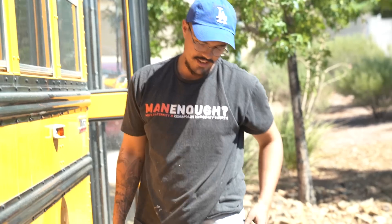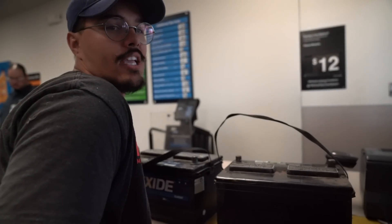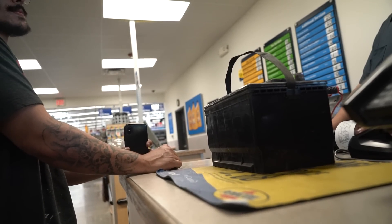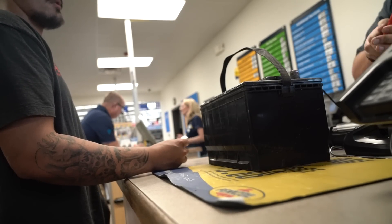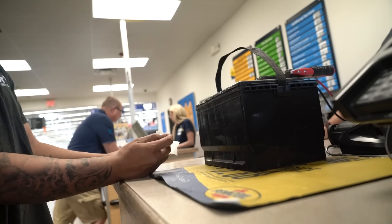This is literally the hardest battery change I've ever done in my life. Usually you just take off the two clamps on top and pull the battery out. We're hoping they have replacements — trying to find a battery with 1200 CCAs, which is gonna be a special order. These you'd want to leave strictly for the engine. If you're turning it into an RV, add a solar kit and run deep cycles. This one says charge required but it's so low on cold cranking amps I wouldn't bother. This one might be salvageable but I'm just gonna get two new batteries.